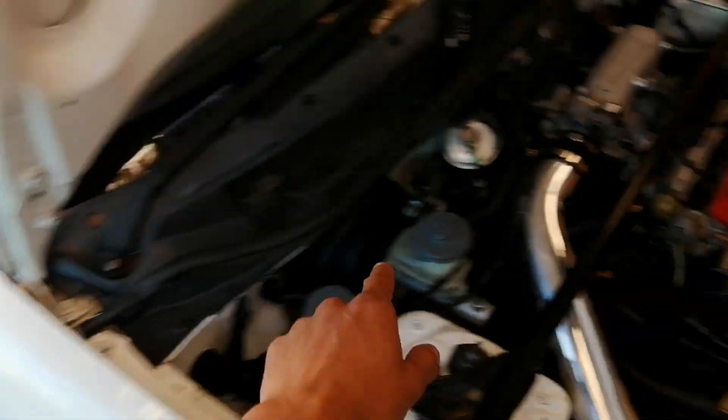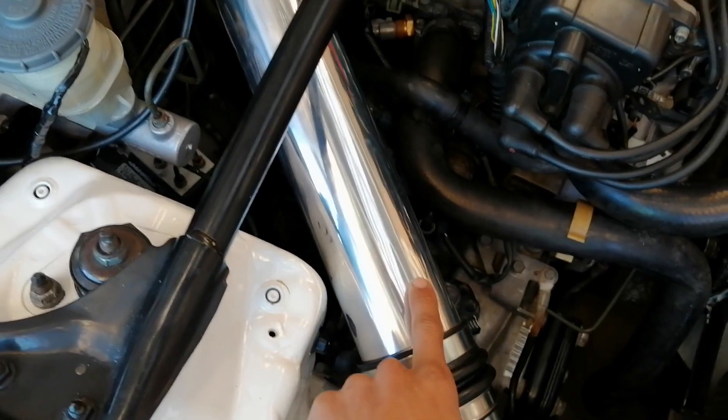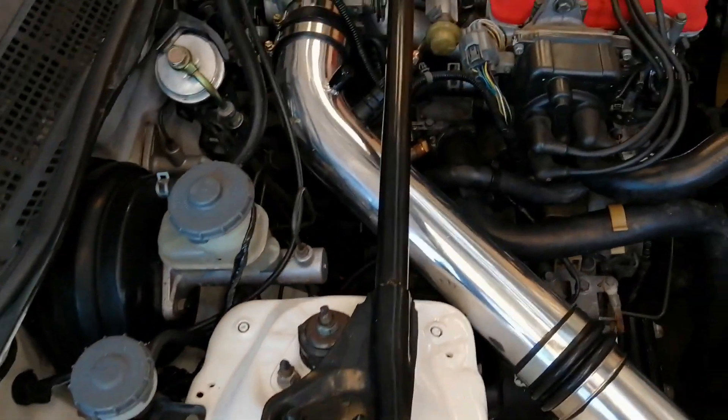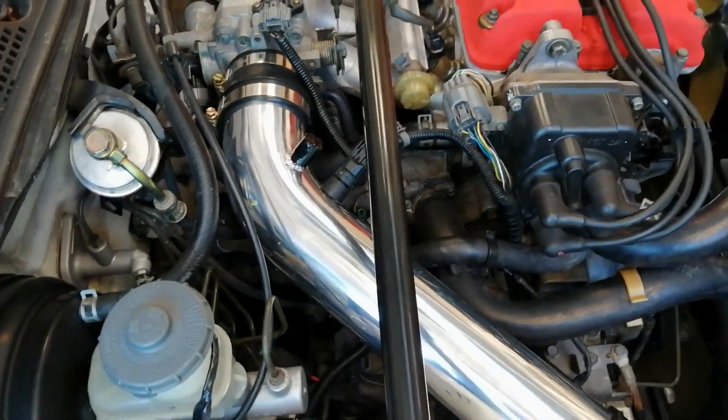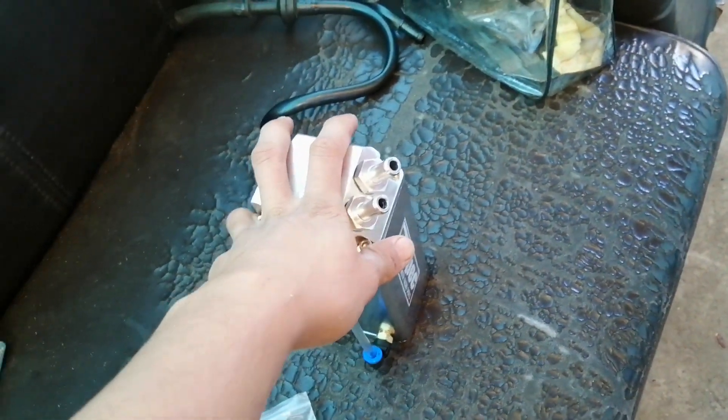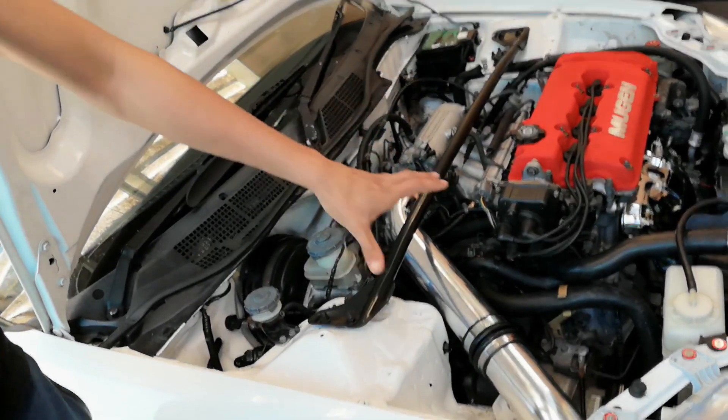If you run it all the way into the corner, you can see it's quite a distance and I don't think that pipe will cover the full portion. In my current situation, I'll be running one fitting to the valve cover and the other fitting I'll just run down underneath the car, since I've already taped up the induction connection. That way it will still breathe properly. What do you guys think — should I run another breather pipe back to the induction, or run it to a breather filter underneath the car?